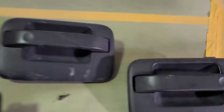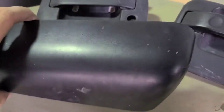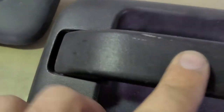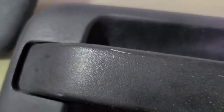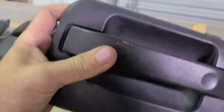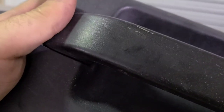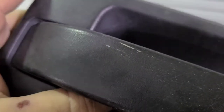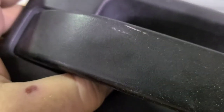What is up guys, today I am doing a color match package on an F-150 and I'm going to show you why you need to sand out the texture before you paint. A lot of people won't charge much and all they do is scuff it very lightly and then just paint it. That is 100% incorrect and it will fail eventually — it will probably peel, crack, the whole nine.